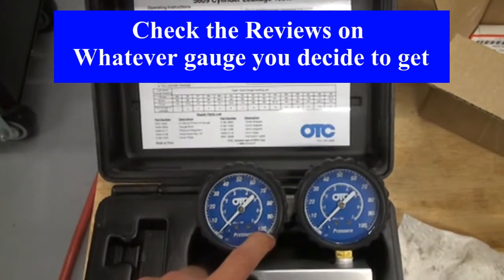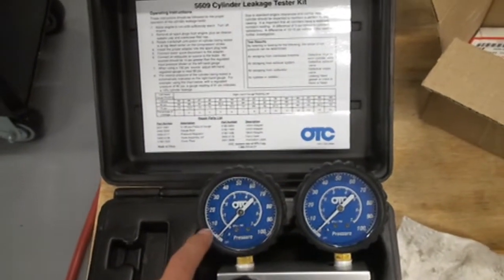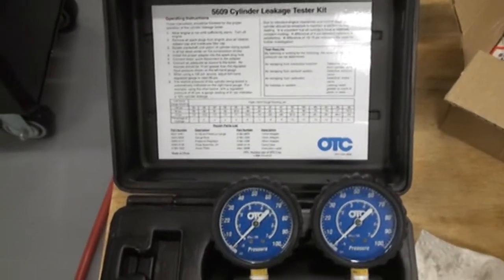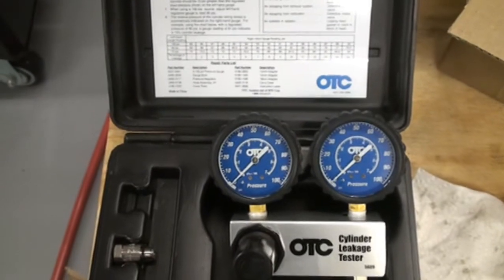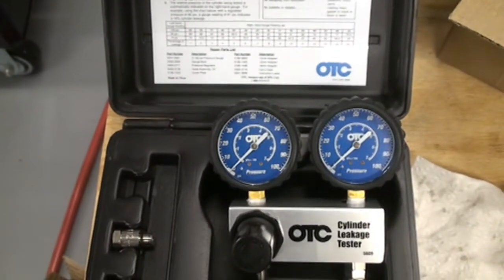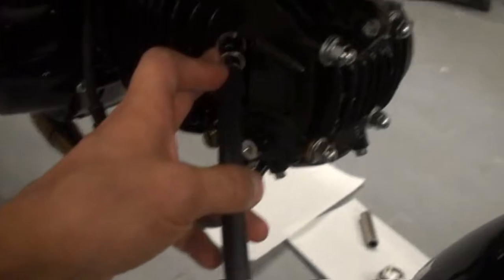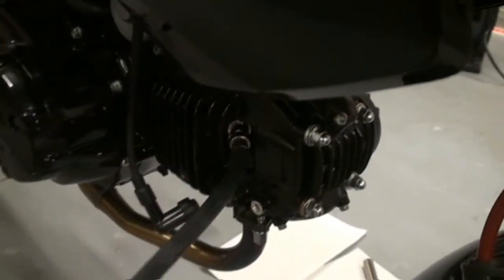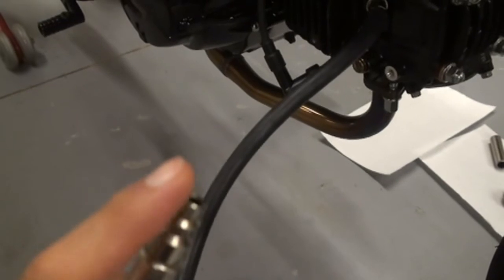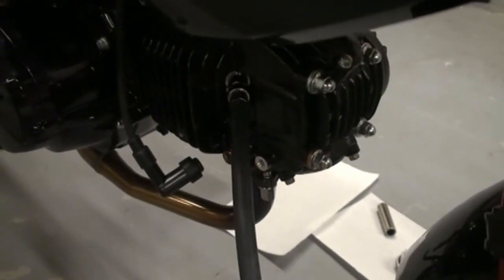Just to show you a comparison - normal compression ratio on a stock motor is usually 160 to 180. So if you're measuring at only 15 psi, how are you going to get a very accurate reading? You want something that actually pushes hard on the rings and makes sure they're seated while it's testing. You can also hear the air better to find out if you have any leaking. Basically what you do is get one of these - it'll come with different fittings and a hose, and a fitting that goes into your 10mm spark plug hole. It'll have 10, 12, and 14mm fittings usually. All this is, is just an air fitting, and you're going to force 100 psi of air into your cylinder. Whatever the variation is, that will be how much leak down you have.